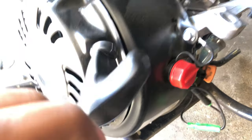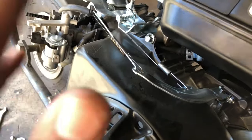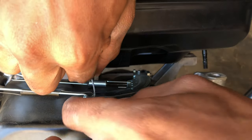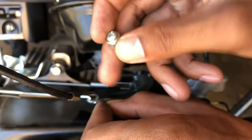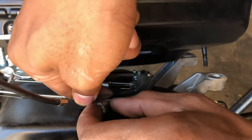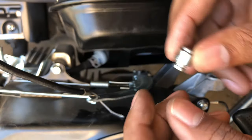One of these open hooks here so the throttle can return back, or you can connect it to the gas tank when you put it back down. For right now we're going to be setting up the throttle. Grab the throttle and just push it through this hole — it's the second hole. Remember when I said you'd need one of these? This is what holds the throttle so it won't slide out. You just need the throttle to get stuck in the hole so it won't move. That's where this comes in — just hold it down and clamp onto the throttle cable.